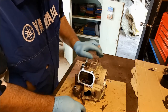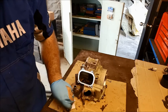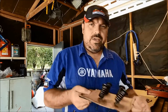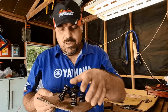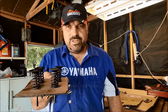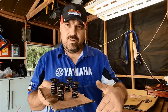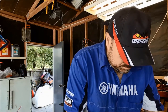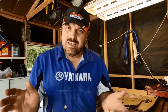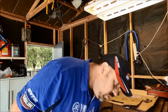I've put plenty of oil on the seals because we're going to be putting the valves in shortly and we want a bit of lubrication on there. It's really important that you label the valves up — they all need to go back in the same holes they came out of, because these are matched valve stems with valve guides. They're worn together. So let's start off with intake valve A, and we'll pop that in with a bit of oil on the valve stem.